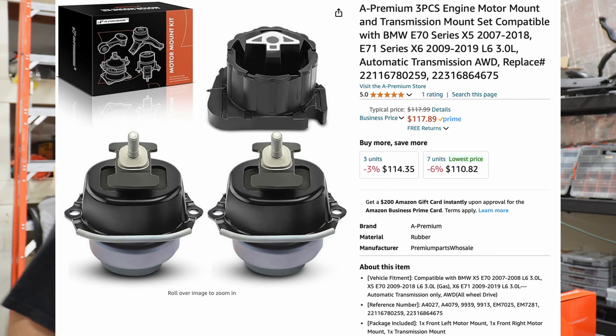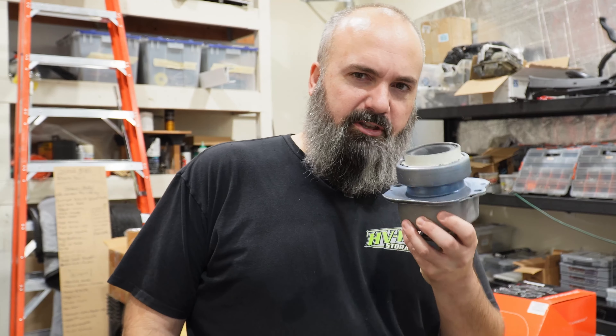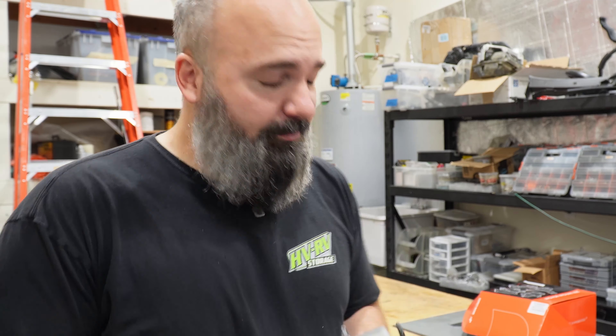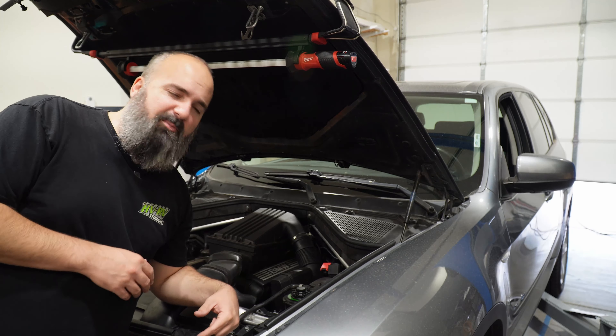And you know what happens? A month after I do the oil pan, I get some octopus black ink — squid ink — on my driveway. It's not oil. It's the hydraulic fluid from one of these stupid things. Same thing happened on my 540, though I had bought motor mounts for that when I was doing the timing guides. But what a freaking bummer. So now I need to do the motor mounts after everything has been back together and running.